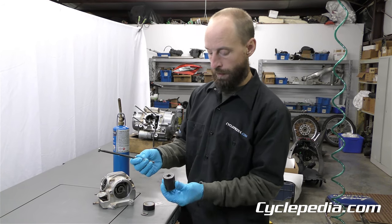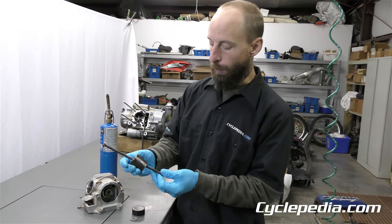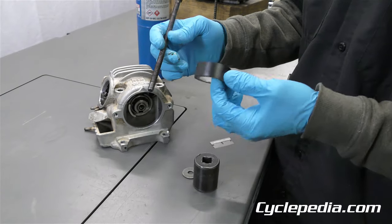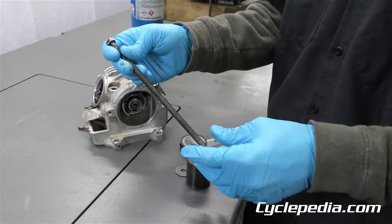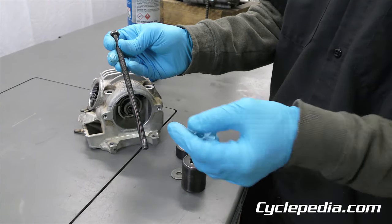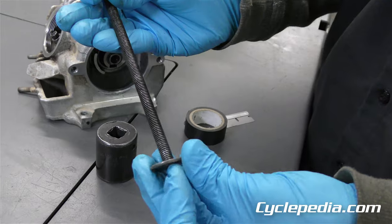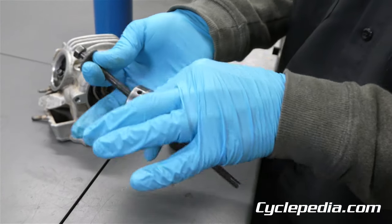Then you're going to take your weight here — this is just a good old Snap-on one-inch heavy impact socket. That should be enough weight to bang against this bolt and act as a slide hammer. This bolt actually goes to one of my crankcase splitters, so I don't want to damage the threads. I'm going to wrap these threads in electrical tape so the socket will slide smoother, it won't damage my threads, and I can use this for another application. Those holes are pretty close to the same size, so I'm also going to use a washer so the slide hammer has something to actually engage.